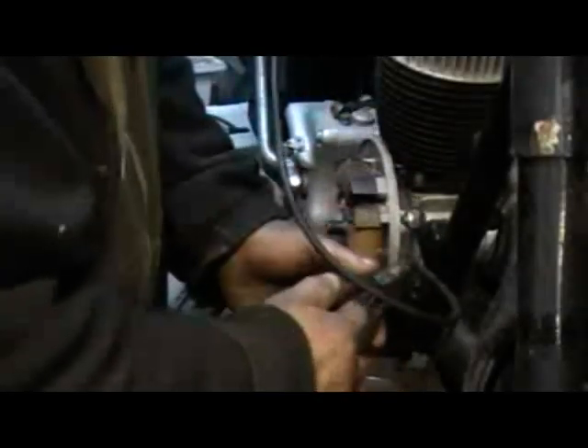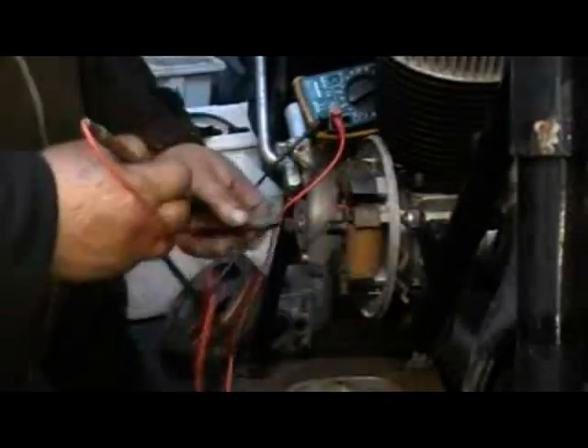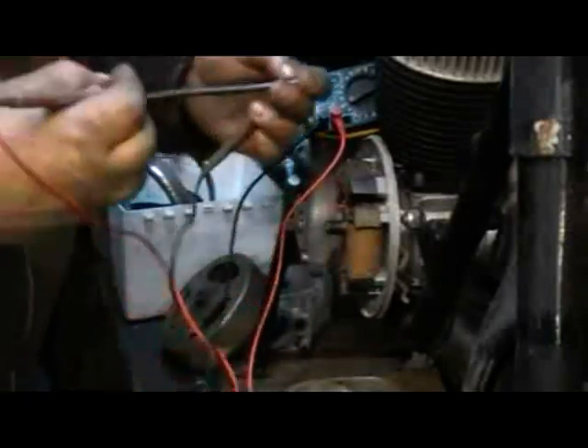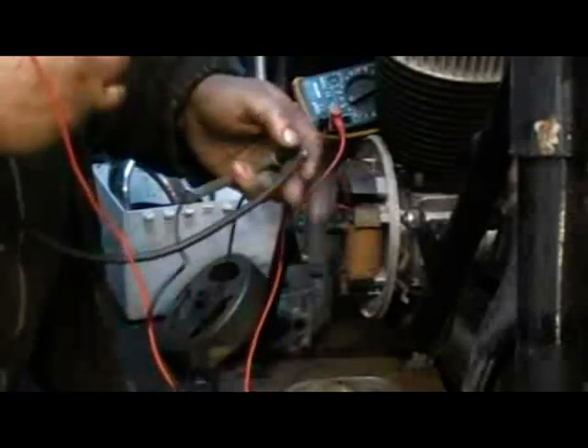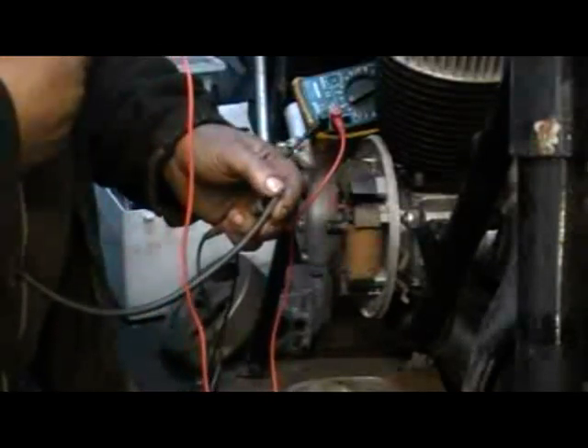As I'm sure you can recall, the James Captain came in with no spark, so I thought today we'd try and find the spark. Here you can see me unscrewing the little Bakelite holder that holds the high tension lead against the ignition coil. Someone had put sealant on this one which made it almost impossible to take out with fingers. Bakelite is very brittle and easily broken, so be careful. First test: the high tension lead, just to check the continuity. This is a copper core lead — they don't normally go wrong, but just in case. Nothing wrong with that, so we move on.